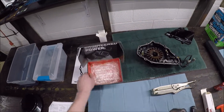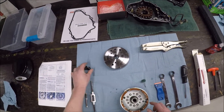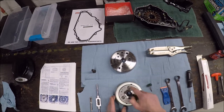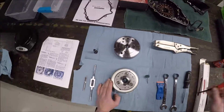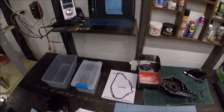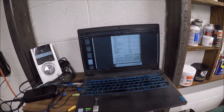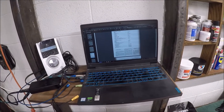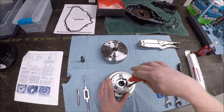From the starter clutch, these pieces are just held in by a spring and can fall out easily. I need to move the starter clutch over to the new flywheel — it takes three 6mm Allen bolts. They were torqued down pretty hard and were difficult to get out, but I've got them loose now. They'll get torqued back down to 25 foot-pounds, which is not insignificant.